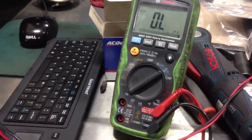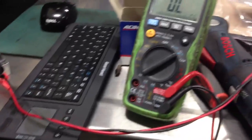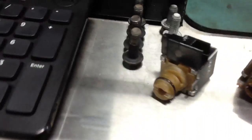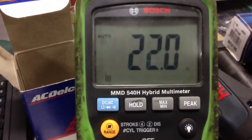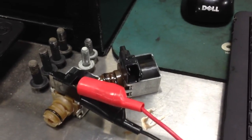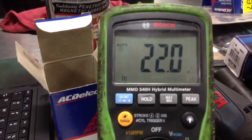Okay, just another quick clip for those of you who like advanced diagnosis and voltmeters. As you can see, I have my voltmeter connected on resistance to the old solenoid and we have OL — that stands for out of limits by the way. Now let's go ahead and disconnect it from the old one and connect it to the new solenoid and see what our resistance is. And bingo — 22 ohms. That is perfectly in spec. There's the problem: an open solenoid. There's the fix: replace it. Costs about 17 bucks.